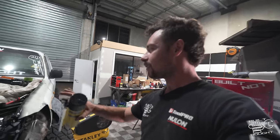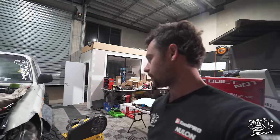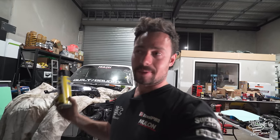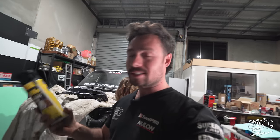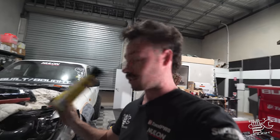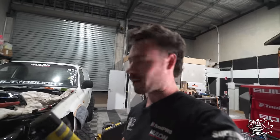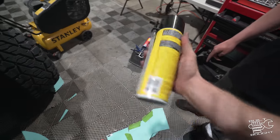The polystyrene would have been a big headache to make fit the shape of the car and trim it back, but this stuff will just grow into any position you want. If you're a panel beater, comment below how you would have done this — I'm sure there are way better ways, but we're just playing with different foams, glues, fiberglass, and metal filler to make it happen. It'll look good in the end. You have to shake the can vigorously for 60 seconds and screw the applicator nozzle onto the cap.